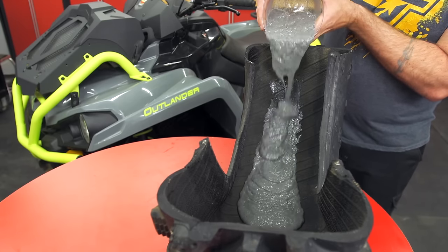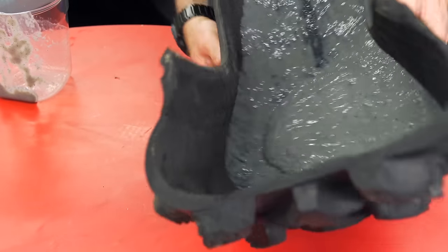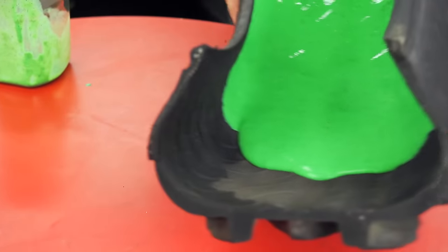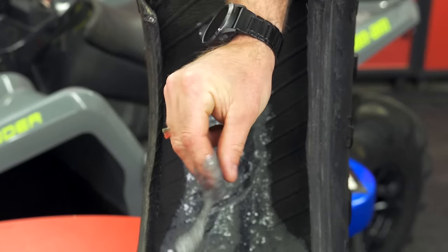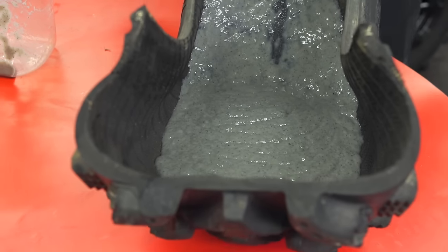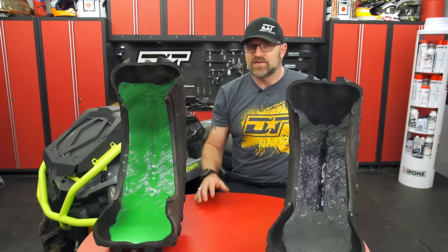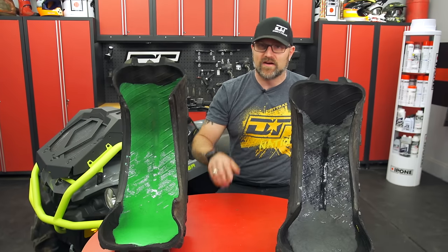Let's look at the higher viscosity gel type with fibers mixed in. When you apply these thick gel formulations, they start to flow around the inside of the tire, but you'll notice that while they do cover the puncture, particularly in the tread area, they both tend to clump up and frequently cause tire imbalance issues. This may not be a problem on a slow-speed rock crawler or even a swamp buggy, but as the speeds begin to rise and you're really able to open it up, your teeth are going to start chattering from the tire imbalance.